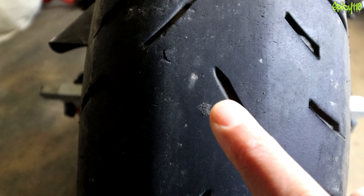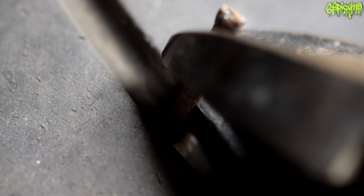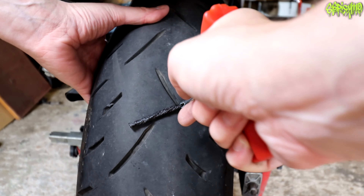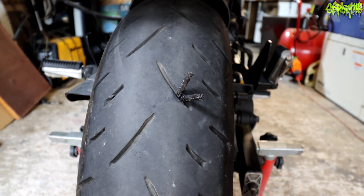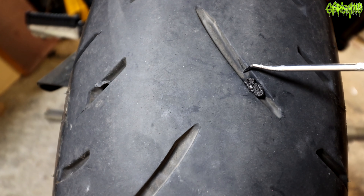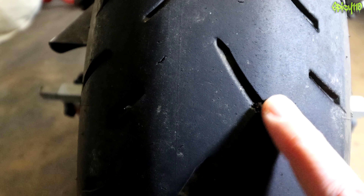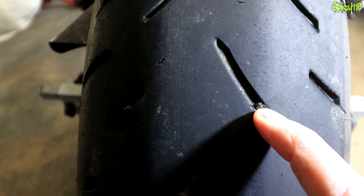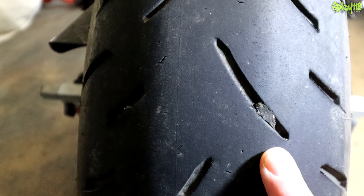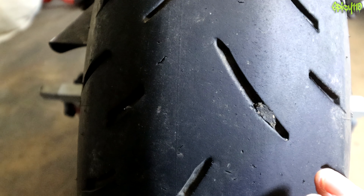The second video was me showing what it looked like after a couple of thousand miles, and in that video I found another nail in the tire, so I had to do a second plug at that point. If we look for that — there it is. This plug is down in a tread groove. I haven't been able to cut it completely flush, but it's flush across the surface — just a hard, squidgy piece of rubber that's been in there for 4,730 miles, and again it hasn't leaked anything.